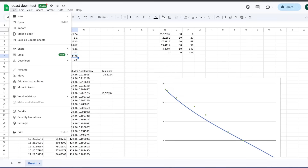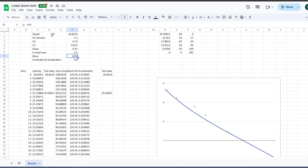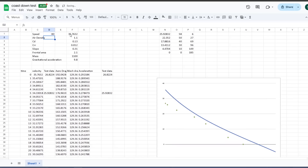In the spreadsheet, you input speed in miles per hour here, and it gets converted to meters per second since everything has to be in metric units. For air density I put 1.1 — there is a formula you can look up based on elevation and humidity. I looked at the test track's elevation of about 2,000 feet and estimated a 70-80 degree Fahrenheit day with about 50% humidity, giving a guesstimated air density of 1.1.